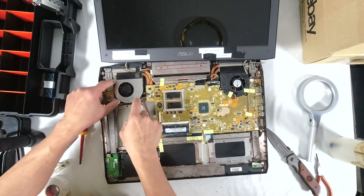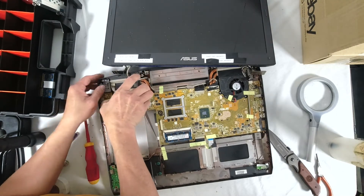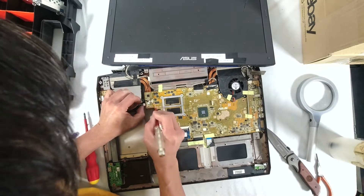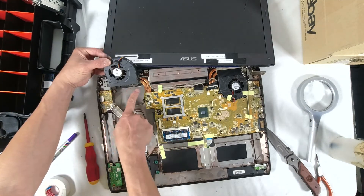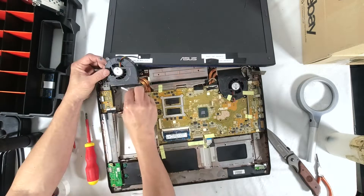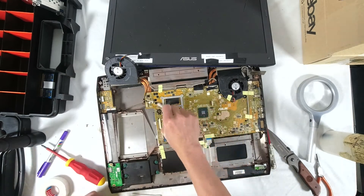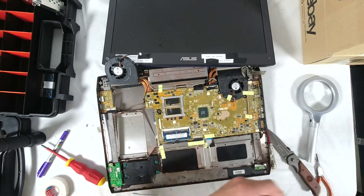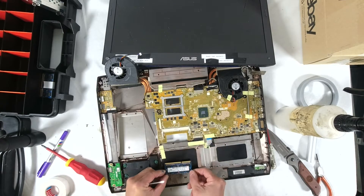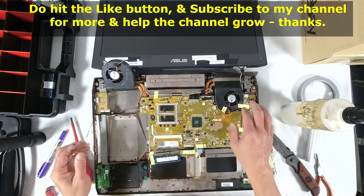To give the fans a better clean I'm gonna remove them — three screws here — so that I can clean the underside. Just need to pull out this connector. Look at the dust at the fan outlet. I have to clean the slots of dust because if they're covered in dust the hot air cannot be extracted. This is isopropyl alcohol so it will evaporate — in fact this is 99.9% alcohol so it's highly evaporative. I'll remove the RAM and give it a clean on the contacts as well. Now remove the fan on this side and clean it.